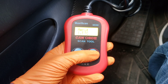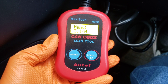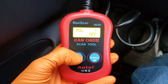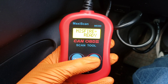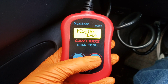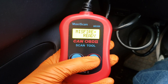We're not going to erase it — I'll leave mine on there, but this is where you would erase it if you wanted to. Option three is I/M Readiness — that's your system status. This is a really good option to use before you go to have your car tested for emissions. We can see that our MIL is off — that's our malfunction indicator lamp, just another way of saying your check engine light. Scrolling through the monitors will tell us if our car is likely to pass emissions or not. We want to see 'Ready' or 'NA' on all monitors; we do not want to see 'Not Ready' or 'No.'